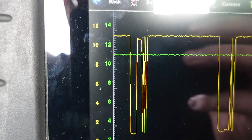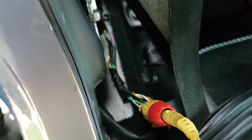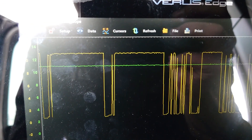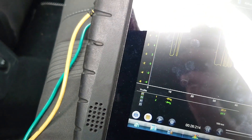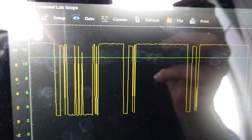The outer wire is that green trace on the blue and grey wire, and the yellow trace is where I've picked it up inside the door loom with a Pomona probe. Inside here somewhere, where the connector joins to this side, I've got voltage there but it's definitely dead — it's not the same signal on either side. I think I need to get this plug apart and see what's going on — is it corrosion? Nothing looks particularly wet, but there's clearly a difference from one side to the other.